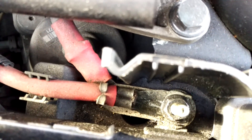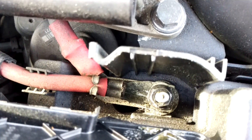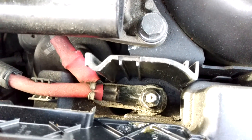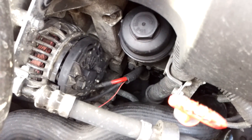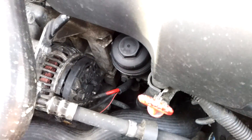So that's the voltage drop between the alternator post and the battery connection. Considering it's a direct connection with the cable that runs around the engine and goes directly to the alternator, that means there's either a problem with the cable or a problem with the connections. Looking at the connections down in there, you can see all the muck that's gathered up around them. I'm going to take those off, clean both ends — on the alternator and on the battery post — get them buffed up to clear metal-to-metal contact and see if we can bring that voltage drop down.